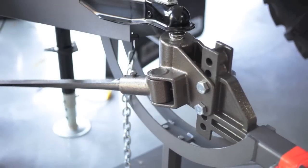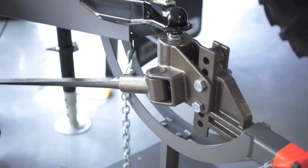Now that brings us to our next important piece of equipment. A weight distribution anti-sway hitch is always a good idea. It doesn't matter how big your truck is or how small your Airstream is. Trailer sway can happen on a little cargo trailer. I'm sure you've driven down the highway and seen them swiveling back and forth. Airstreams are much less susceptible to trailer sway than other brands, but it's a good idea to have one of those on there. Here at our store we sell the Blue Ox, but there are other brands out there. I use a Pro Pride.